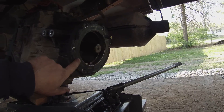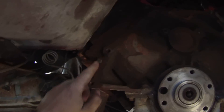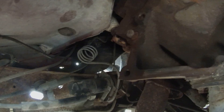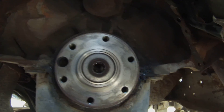We were going to take it out with the transfer case on it, but we ended up taking the transfer case off because we had a lot of trouble getting the transmission out. The reason was partly due to the dowel pin rods - one of them is right here and it's really corroded, really rusty. We had to really shake this thing off. There's another dowel pin rod on this thin sheet metal inspection cover, which we'll show you.